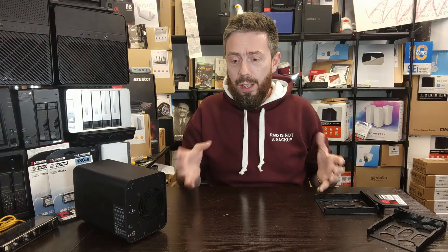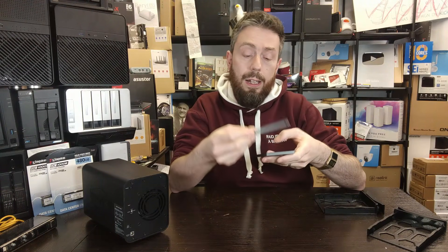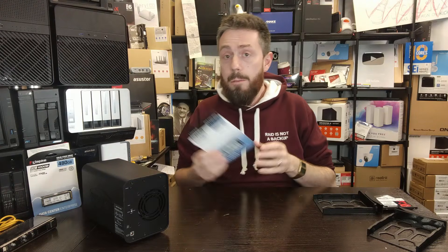Many of you will notice that none of those results fully saturate the external connection. With two SATA SSDs each delivering 400–500 megabytes per second, RAID 1 does allow simultaneous read and write access which can provide a performance boost — but still neither configuration alone would fully saturate a 10G external connection.